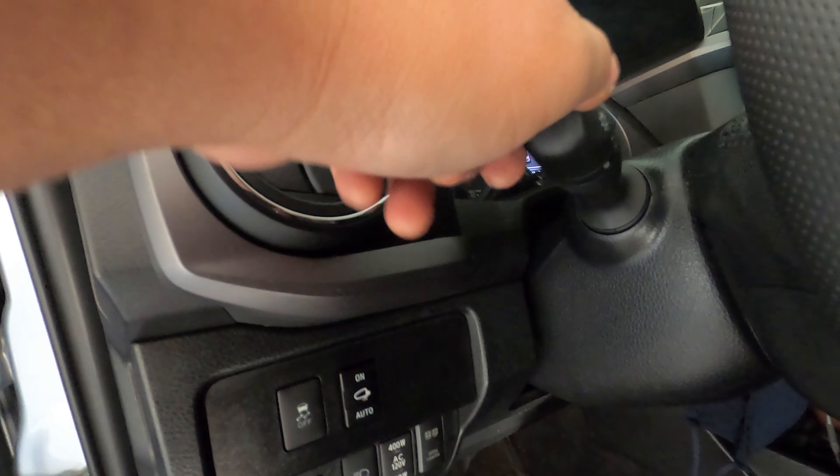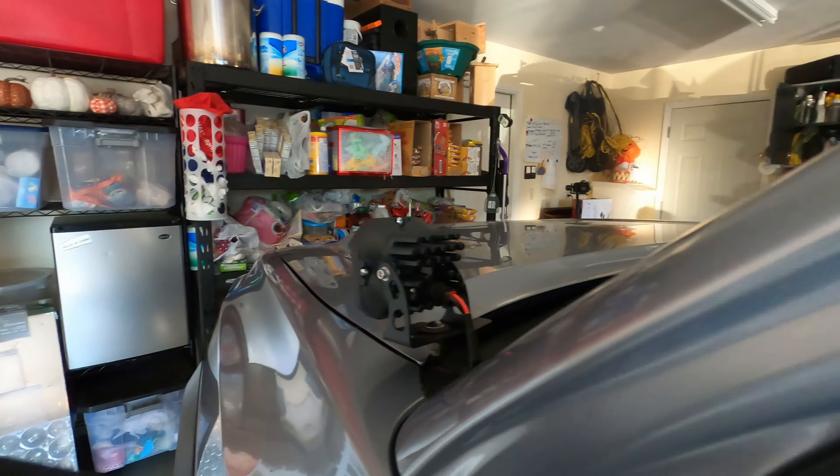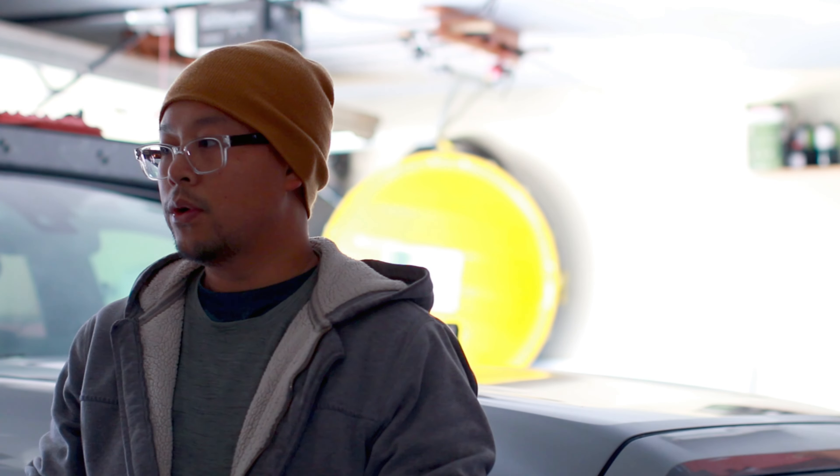When you flip on the light switch it should illuminate, but the ditch lights are off. When you hit the button, that lights up and your ditch lights are on. Overall pretty easy and straightforward — it just takes a little time if you want the wires nice and neat. If you just want to slap it on, maybe 30 minutes to an hour, but it took me many hours with the filming and making sure the connections are tight. In the next couple days I'll double-check the crimp connections, the battery connections, and make sure nothing is binding as the hood articulates up and down. Everything's looking good and working good — thanks for watching, we'll see you next time.